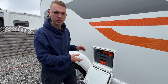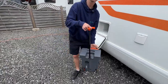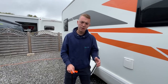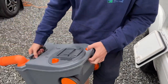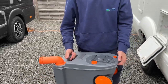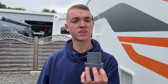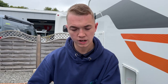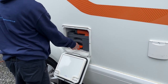You have your toilet cassette here — it lifts up and the cassette slides out. You can carry it by the handle on the front, or bring the wheels up and wheel it to the waste disposal point, which is normally beside the toilet and shower block on site. To empty: remove the grey cap off the spout, start to tip and press the orange button at the back of the cassette to allow air in, stopping the glugging, and pour the contents out. Rinse with a small amount of water, then add a cap full of liquid — green or blue depending on the site's regulations — and it's good to go back into the motorhome. It simply pushes in and clicks into place.